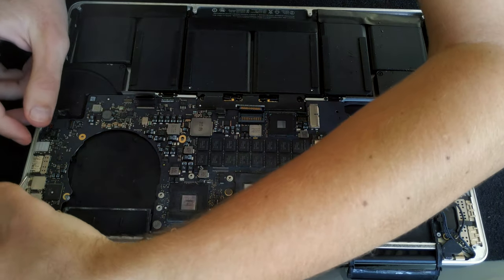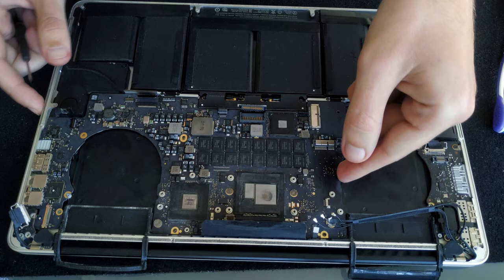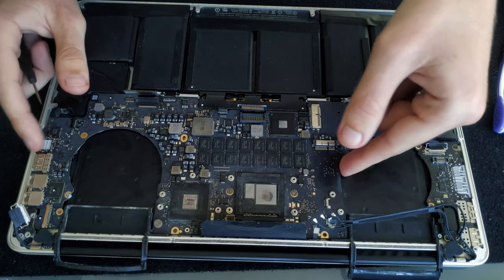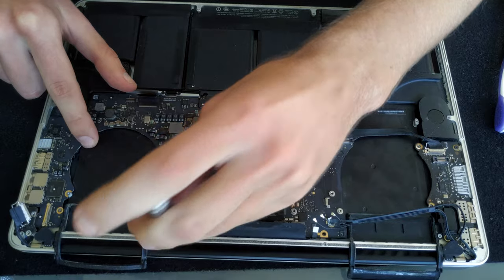When the board is finally down you will probably notice the screw holes do not align properly, so push the board a little bit to the left — allowing the arms to go above the chassis — and after that you can put back the screws.